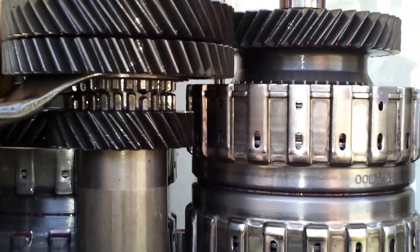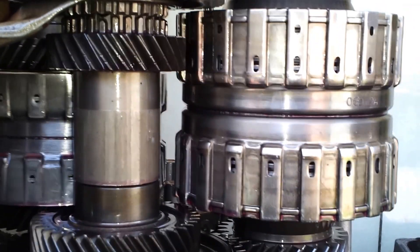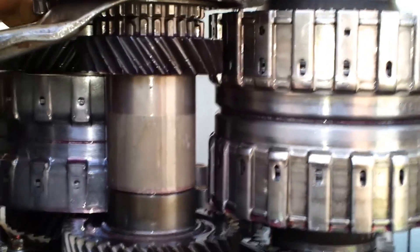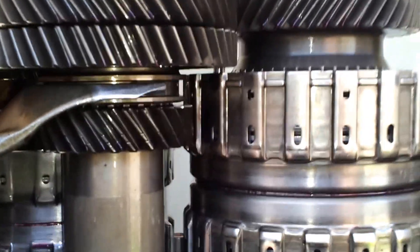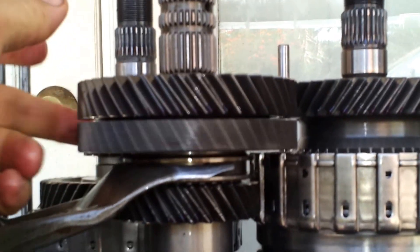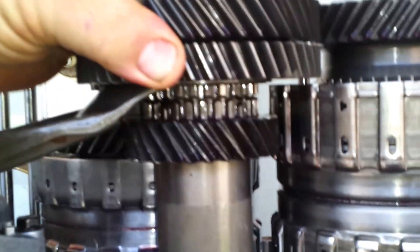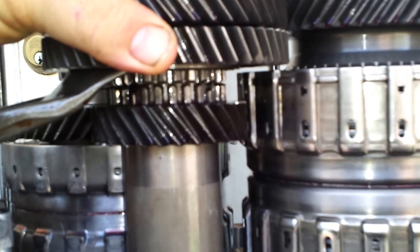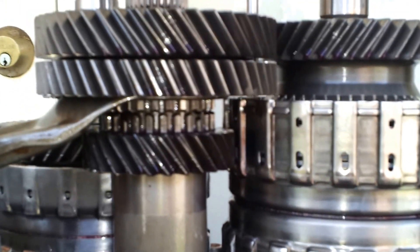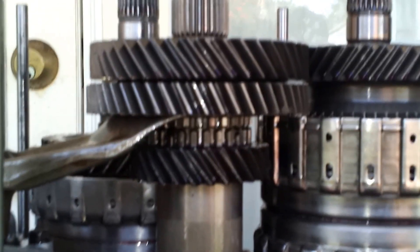See that? A little tension in the parts kind of makes them want to do their thing. But as soon as I put it down, this down position is actually a forward gear action. This one would be your third gear selector. This would actually be in park and reverse, including the fourth gear clutch. I'll show you it installed the wrong way in just a moment.